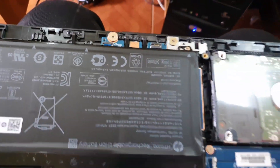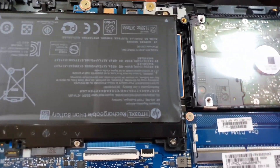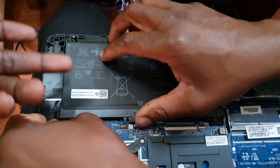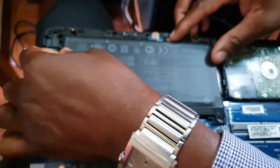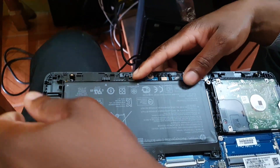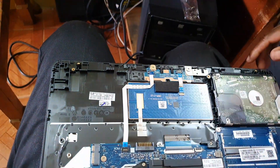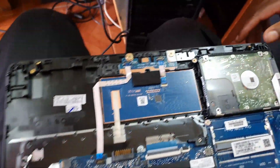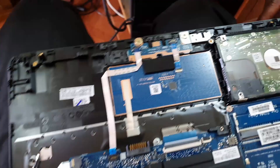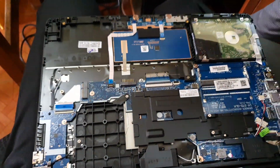You can snap the RAM back into place when finished. Over here you can see the battery. The battery is held down by about five to six screws — once you remove those, slowly lift it up. I don't mean one aggressive motion — slowly lift up. Notice it slides into place and there are screws that hold it, plus a main latch that slides beneath. Once you remove that, I've also removed the Wi-Fi card — that required a single screw and one clip.